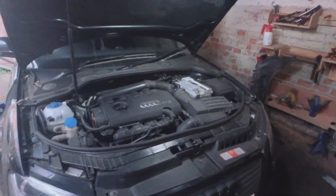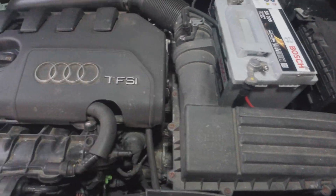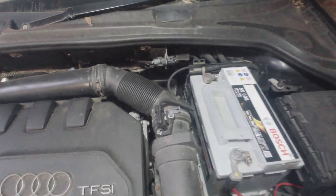What we're going to do first is remove the battery and work at the top first. Remove this airbox - take it off from here so that we can just get to that oil filter at the top. Let's go ahead and do that first.